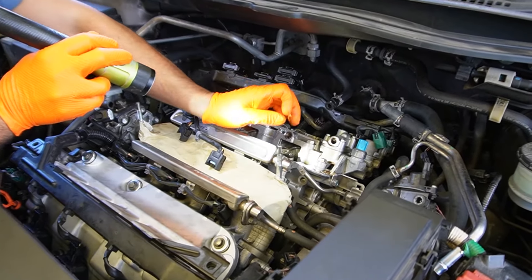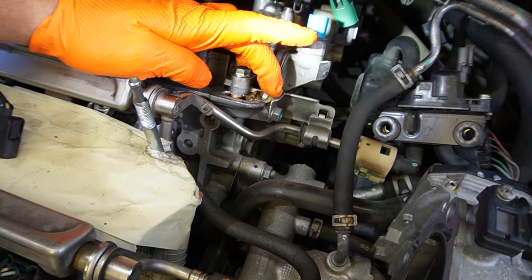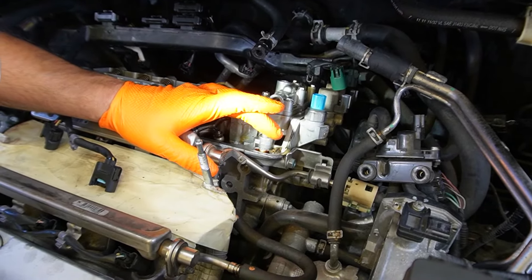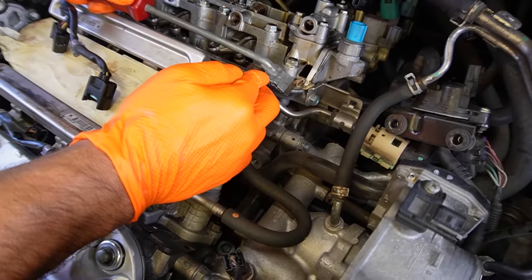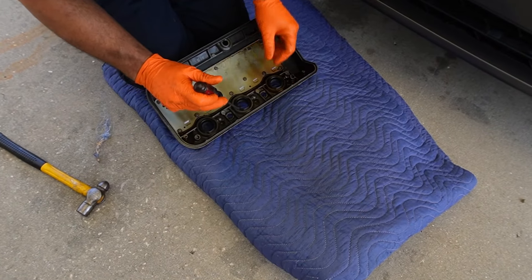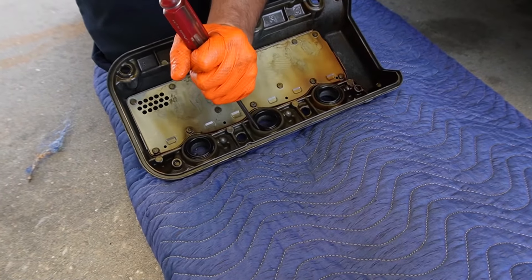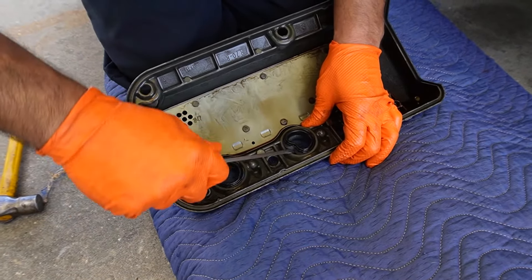Let's go to the next step — cleaning this out. We're going to clean that silicone and gasket that's been laid on here. There's going to be one here and one in the back. We're going to use the same process: scrape away from the cylinder head, making sure we don't get any in the cavity. Stick a screwdriver right in here and lightly tap, then remove the gasket.